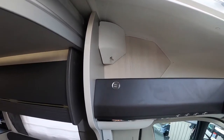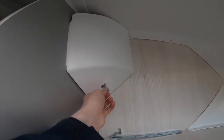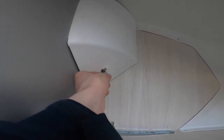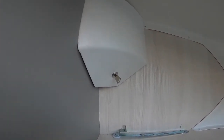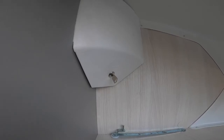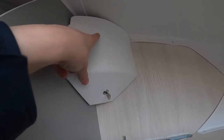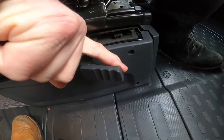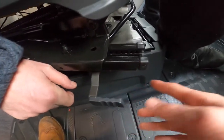You can drop your double bed above your lounge — it only comes down so far so you don't need to drop the table. Put your ladder on here, which is underneath the bed. You've got nets should you put small children up there, connecting to the bed frame and ceiling to stop them rolling out. Make sure the duvet isn't caught between the connection because that's when your lights won't work. There's also a small rocker switch on the side of the kitchen cupboard for the light for the people in the double bunk. To stop small children playing with the switches, you can isolate the switches for the sinks, back bed and front bed. Should the electric fail — i.e. flat leisure battery or power issue — take the key out, take the cover off, and use the winding handle supplied in the pack to wind the bed up manually.